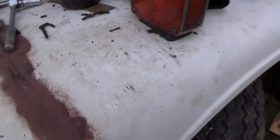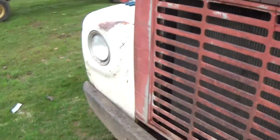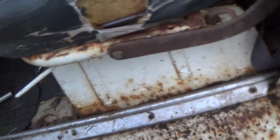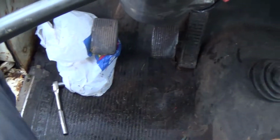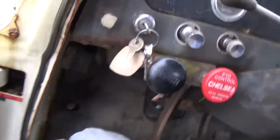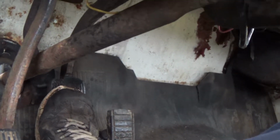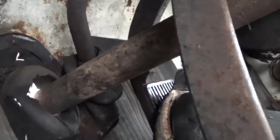I've had a lot of little troubles on the way, you know, like every little job does. But I've got it to get quite a bit more pressure than it had, brake-wise. I mean, the brakes are just like a nightmare. I just can't get them to get very good pressure. And I don't know why. That's why I suspect the hydrovac has piston problems or something, but it stops right there. Stops right there. At least on the first pump. After another 2 pumps, it'll be fully good, and of course then it'll go back down.